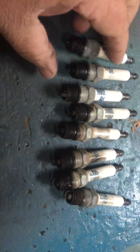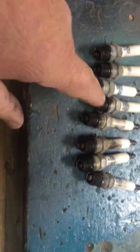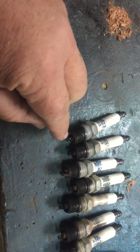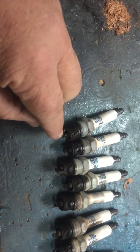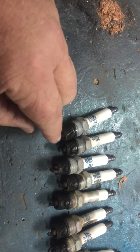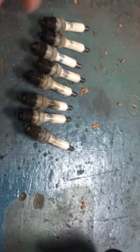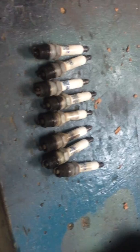We got a new starter on the way. I would suggest that I go back in with new plugs — I'm planning on just purchasing new plugs to go back in with rather than taking these old ones. They're pretty carboned up, and the carbon will become a path for the electricity to get across the electrode. So it'll weaken your spark, if not eliminate your spark, and make you run without one cylinder or two or three — and that could progress.